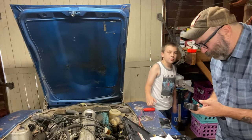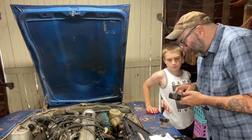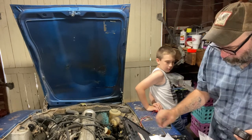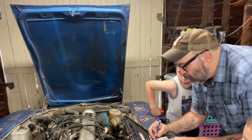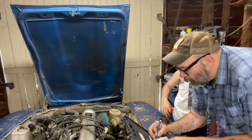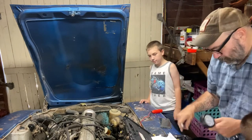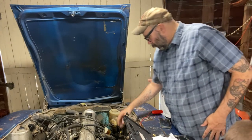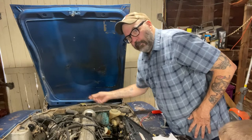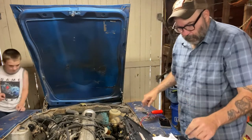Whoa. It's pushing out against it. Hold on. Okay, try it. Hold on. Wait. My face got blown with like a bunch of hair. Sorry. Go ahead and do it again. Okay, stop. So, yeah, we're just shy of 150 there. That's a lot better. Yeah, 130, 140. It's like 147. So let's do that one. Number six. I'm going to call that just shy of 150. Okay. Now it's time to get the wire out of here and find where it goes on the distributor. It's the right wire. Yeah, and that's the deal.